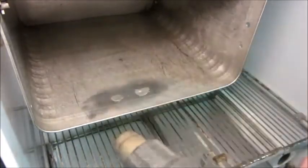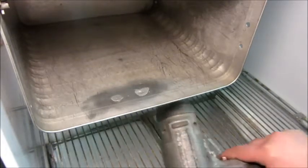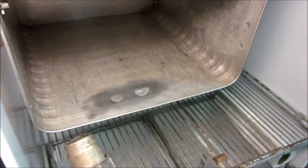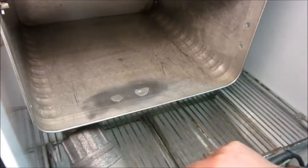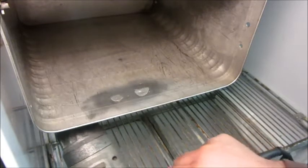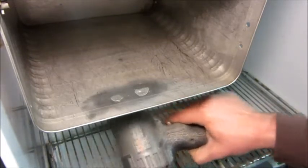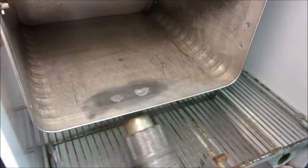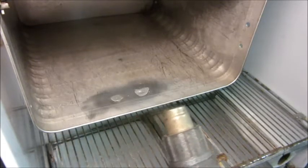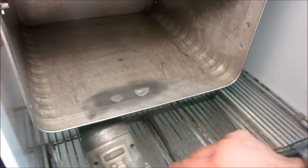While the vacuum pump is running and once this is hot, I'm going to start stripping out the old wiring because the wiring is really hard on this — it's not cracked yet, but it's hard as a rock, and I know the first time it gets moved it's going to break. I don't know if y'all saw David Gray's video from the Kelvinator that burned in someone's house — the insulation they used from the factory had paper backing. The wiring failed and it actually set itself on fire and smoked up the wall and the bottom of the cabinet. This one doesn't have any insulation down there, and if I put any back it's going to be that duct liner stuff that's fireproof.